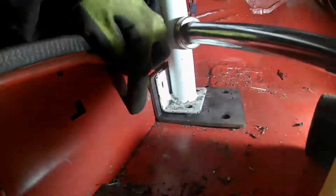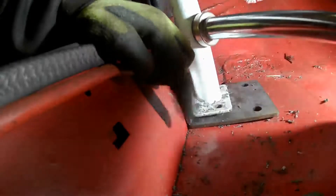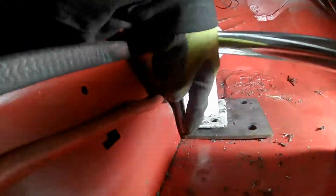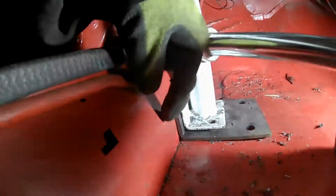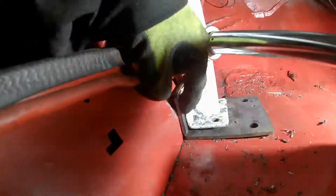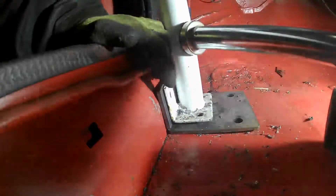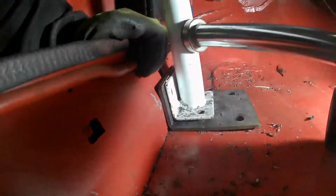As you can see there's a nice little contour just there, so it's not going to sit very well on this sheet metal. What I'm thinking of doing is: once this plate is tacked to this plate, I'm going to stick a nut on the back of this plate, drill out a bigger hole so it goes through this section, and then we can just bolt it to this. Because once this is welded to this it'll all tie in, and it'll be bolted down in four places already and doesn't need to be bolted to the side. It's just a reinforcing plate for this part of the leg.